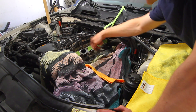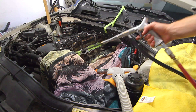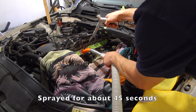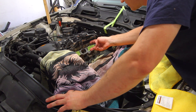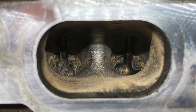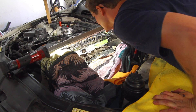What works best is to get in there with a scraper first, scrape up any loose carbon, and then vacuum that out. I'm just going to vacuum out the loose debris right now. After sucking up the loose stuff, put the vacuum head back in, connect the walnut feed to the blaster, get the vacuum on, and start spraying walnuts. The first pass is usually pretty impressive. I find the walnuts really dry out the carbon — when you first go in, the carbon is wet and sticky, saturated with oil. The walnuts absorb a lot of moisture and make it easier to scrape things up. After blasting, get back in with the vacuum and suck up what you scraped loose — it collects all the loose stuff and makes it easier to go back in with more walnuts.